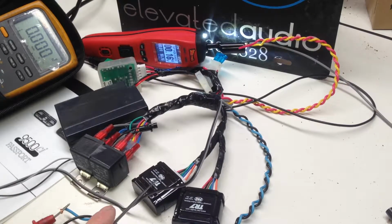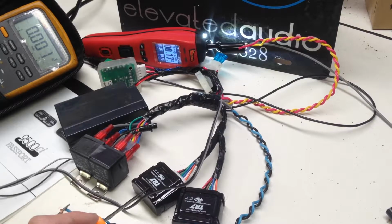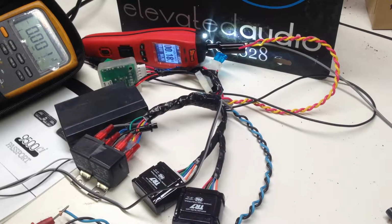We're using a TR7 for a delayed turn on, 14 seconds. I set that up so if you get in the car and turn on the ignition, you have a little bit of time before the 9500 tries to start up before you crank it over, because during crank it also sometimes trips that check receiver wiring.